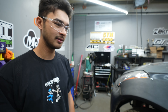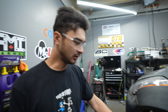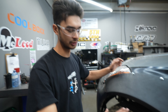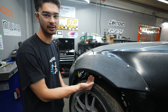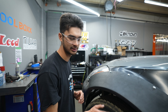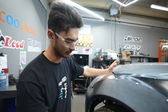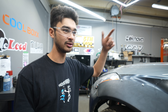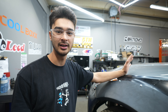For fitment — do we need a wheel spacer on the front? When we lower the car, the control arms even out and push the wheel out. If you're really getting after it you could put a 10mm spacer for super flush fitment, but for our purposes the wheel coming out to here looks fairly flush and good. Once the BC Racing coilovers are installed and the ride height and fitment are dialed in, it should look sick.